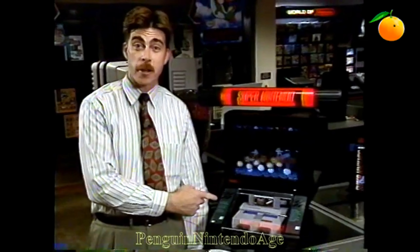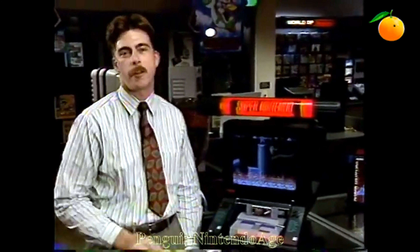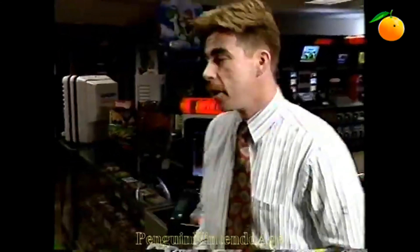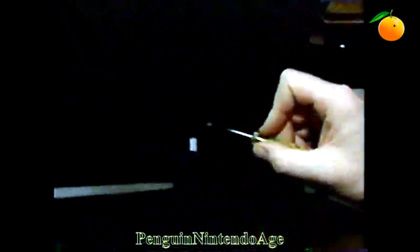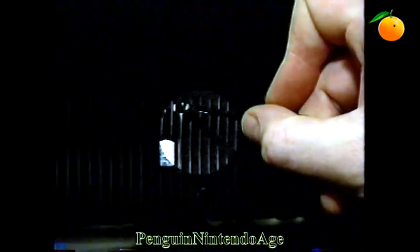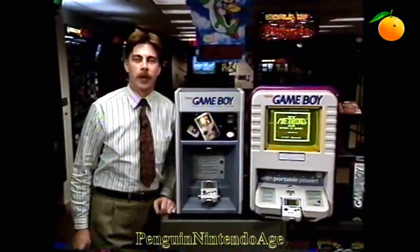Does this look familiar? This is just like the other unit we just saw, only the countertop version. The inside workings are just like the other ones, so I'm not going to bother showing you that. I do want to show you how to set the volume on this one — come around to the other side. Again, look for that little blue block where the timer settings are made, and find the little screw head driver adjustment right above that. Put in your screwdriver to adjust the volume.